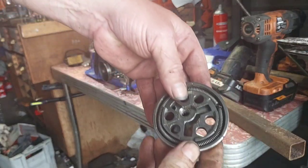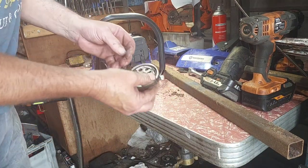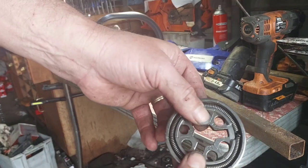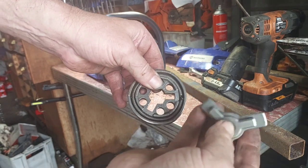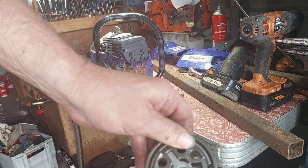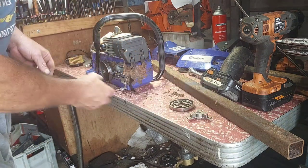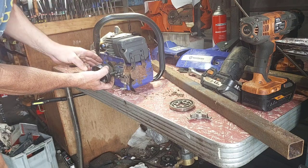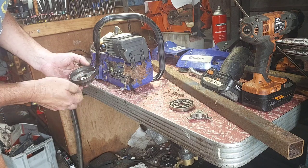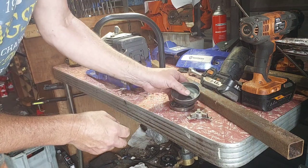A lot of pulling with vice grips - I don't really want to show that because it's a pain to film. What you do is put one part in the vice on the bench, another vice grip here, and another one and pull them onto this part here. That's the easiest way I find. Put it in the vice like that and pull over onto the actual backing plate, but you've got to be careful not to break the backing plate. I think they design these things so you break them. Here are all the bits and pieces - always inspect them and note which way they came.